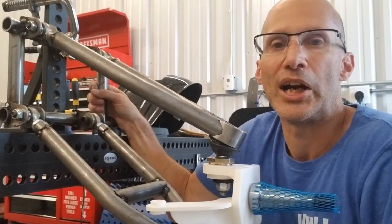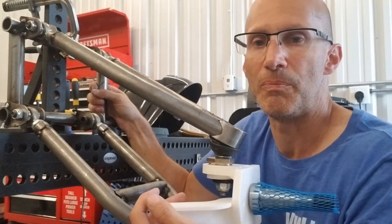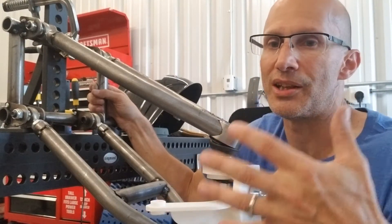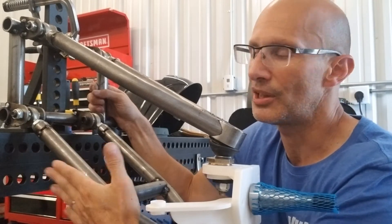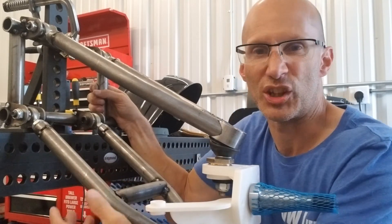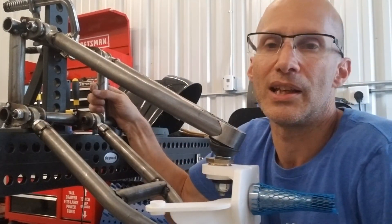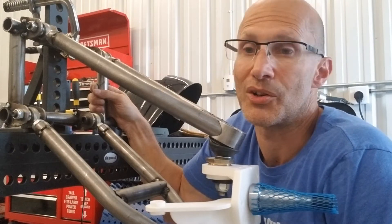With the width equivalent to a four-inch narrowed beam, you can basically put any tire and wheel combination on the car that you want. This steering knuckle is set up almost exactly the way stock is geometry-wise, except forward for the rack and pinion. You can lower the thing down, hopefully with no bump steer and better geometry for handling. I'm really trying to figure out whether to offer this with and without a sway bar. I have a sway bar in the design — pretty straightforward to do — and the A-arm has a hole in the front for an end link. Some people who like lowering their cars way down might want it without a sway bar, so I might offer it both ways.